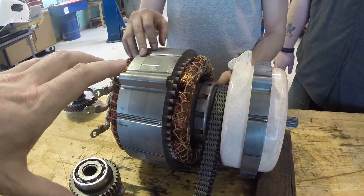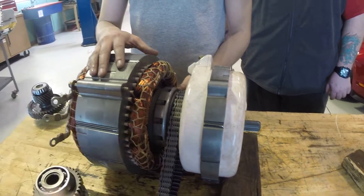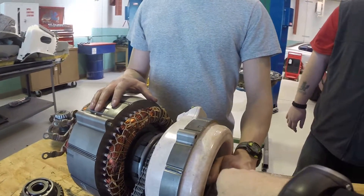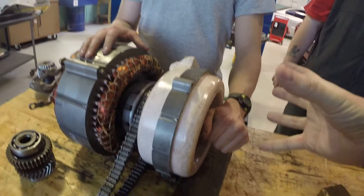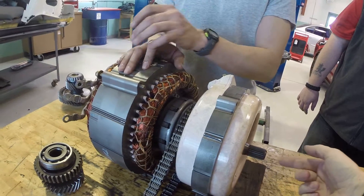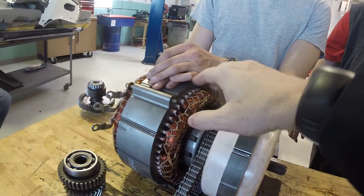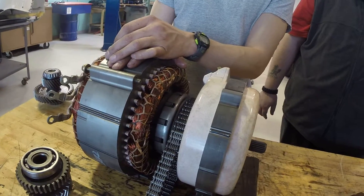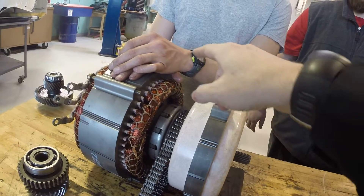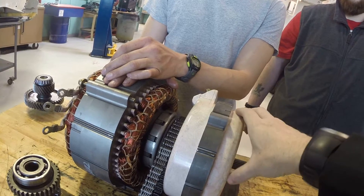There's no transmission — no variable gear ratios. So then what is the planetary gear set doing? It is blending motor drive from the input shaft, which is splined into our drive plate — like the dual mass flywheel — that comes from the engine. The rotation of this shaft is blended with the motivation provided by MG2, and we split the power coming from the engine between helping MG2 and coming back through the sun gear to drive MG1.